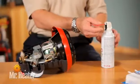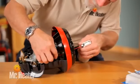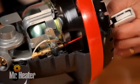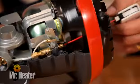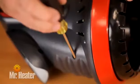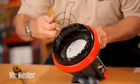With the long plastic nozzle extension on the gas computer duster, slide the nozzle extension two inches into the pilot tube and blow out the tube with three or four quick bursts of air. Now reinstall the right side plastic service panel and reinstall the burner wire guard.